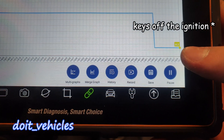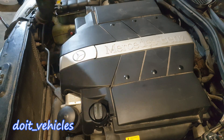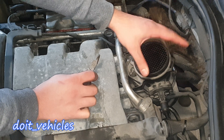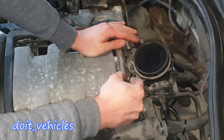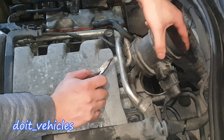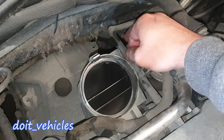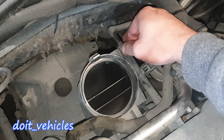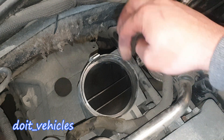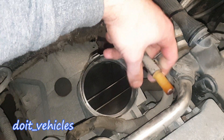The throttle body is programmed to drop to 8.2 degrees from 8.6 degrees. Now let's remove this air filter housing and take out the mass airflow sensor — we've got a clip here. I actually already spotted a problem: this line right here is supposed to provide vacuum to the brake booster. You can see how easy it moves in there, and I'm pretty sure there is a vacuum leak at this connection. You've got basically 2 tabs — press on them and the line comes out.